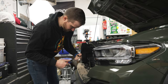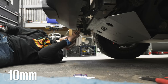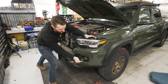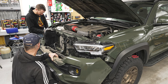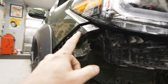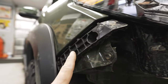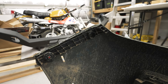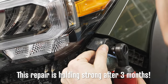We've got four fasteners across the top and one on each side, plus two 10-millimeter bolts on the bottom. With that out of the way, we're ready to take off the cover — we need to unplug the wiring harness for our fog lights. Something to look out for: your bumper cover on both sides is just wedged in and kind of popped in. On the passenger side the bracket held just fine, but unfortunately on the driver's side, that bracket snapped. It turns out this piece isn't easy to get or cheap, so we repaired it with epoxy and hot glue — good as new, pretty much. We were also able to find an aftermarket version of that fender clip.